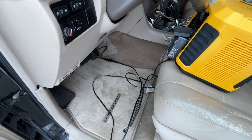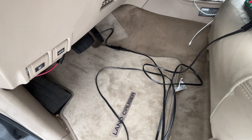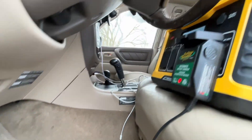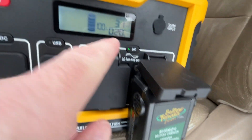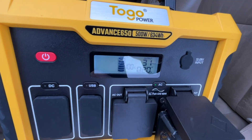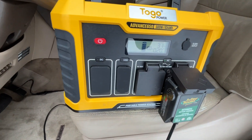Here I'm in my 2000 Land Cruiser and my battery was very weak, so I want to charge it up. I plan on getting a solar setup on this and I'll use the same adapter with my solar panel. I have this plugged into the OBD2 port and into the power bank. Solid red means it's charging and it's drawing 20 watts — looks like it'll run for 31 hours, though it shouldn't take that long to actually charge the battery. I could also check the voltage off of this line. I'll leave this for a while and later come out and get it started.